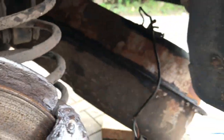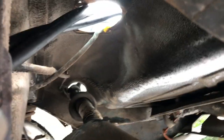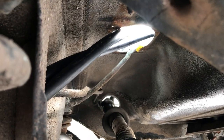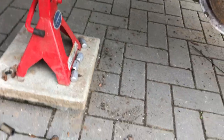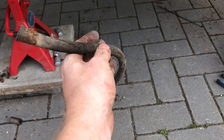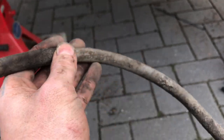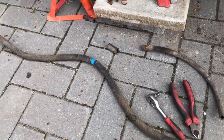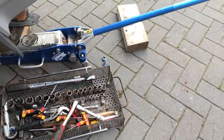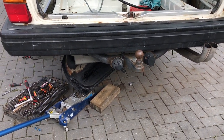I forgot one thing - I have to replace the fuel lines. A little break from remounting the fuel tank because I had to replace the fuel lines from the secondary or main pump, up through the hole. I bought them a little bit oversized so I can cut them to length once the tank is back in. The reason is the state of the old fuel hose - probably 30 years old. It was about 14 euros with new hose clamps, so not a big deal. Let's get back to mounting the tank.